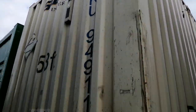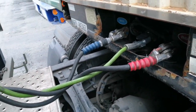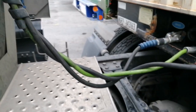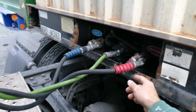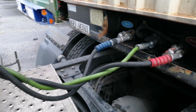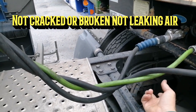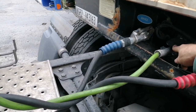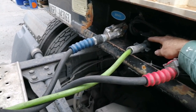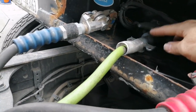These are containers, not trailers — containers don't have clearance lights, but trailers do. Clearance lights are the ones on top. Just to give you an idea of what your lines are. At the tech site: glad hands not cracked or broken, not leaking; air lines not cracked, no cuts or bulges, not leaking; power line not cracked, no cuts or bulges, secured and mounted, latch in lock position.